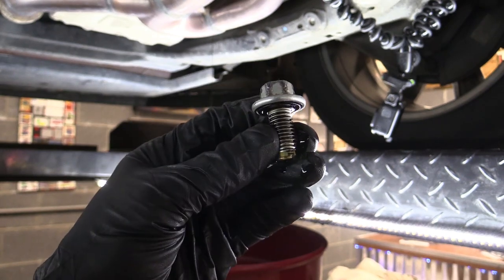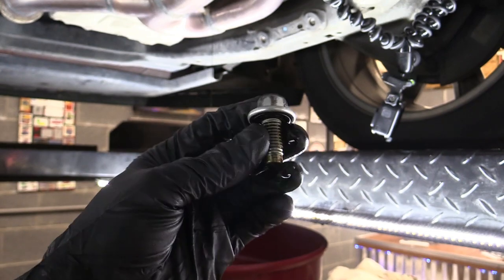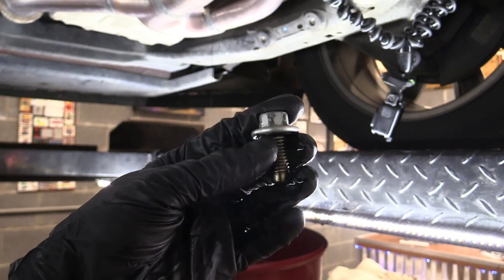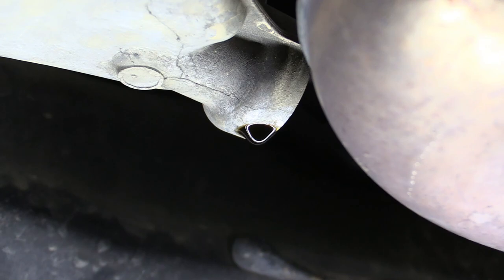This is what the oil plug looks like on the SRX — pretty simple plug. Make sure it still has the rubber gasket intact on it, and that's a 15 millimeter. I usually wait until it's just dripping slowly and there's no steady stream anymore. I realize that's probably more time than a quick oil change allows, but at least I know most of it's out. Go ahead and put the oil plug back in and snug it up.